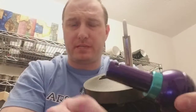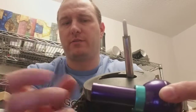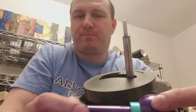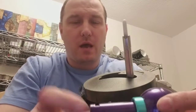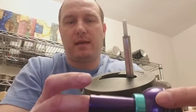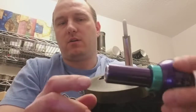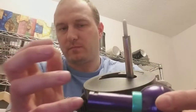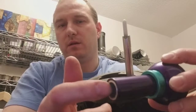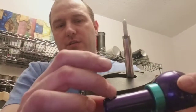I've researched other companies and they have similar adapters where they screw on and stuff. They have access to bigger machinery than I do. But I came up with this system for the Subarus as well. All it is is an adapter that I bore out, and I put a little metal piece in there that slides over the shaft, and then you tighten the set screw.